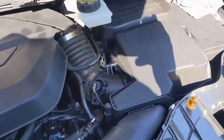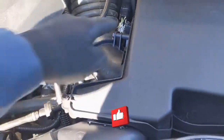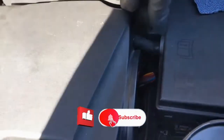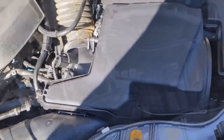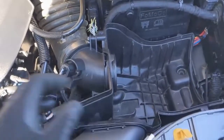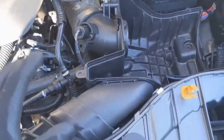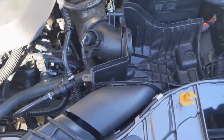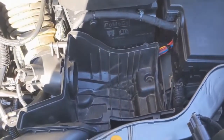The manual has us take off the airbox. There are a couple of screws here — one, two, three, and I believe there's a fourth one back there — and they are 8 millimeter. To pull the box out there's this connector, this clamp gets loosened, and then this little rubber piece gets pulled over, and then it's just held on with a grommet so it should just pull up from that point.